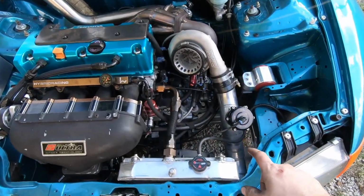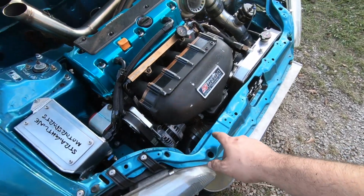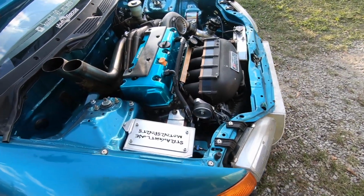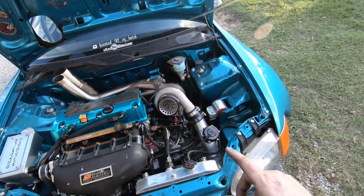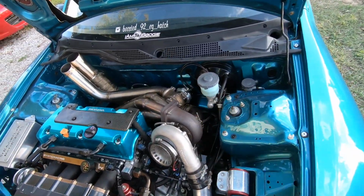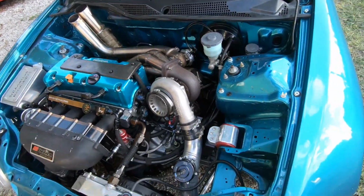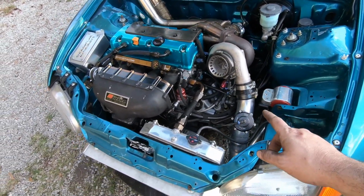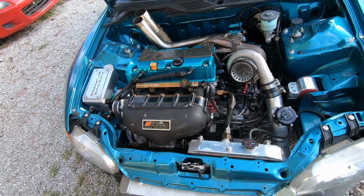Go-Autoworks did the intercooler pipes, so it has 3-inch on this side and 3.5 inch on the cold side. Go-Autoworks also did the up pipes. It has Hasport mounts, a Hub City rear bracket, and a Precision 6466 Gen 2 ball bearing turbo. Got a Tial 50mm wastegate, Turbosmart 60mm, Tial 50mm blow off valve, Tial 60mm wastegate, and it's got a DP Race Parts scatter shield, a Wavetrac LSD, the Gear X 1 through 4, and the trans with RSX 5th and 6th carbon synchros. All the gear set has been REM treated.